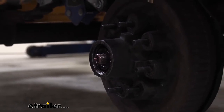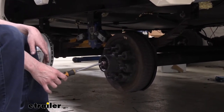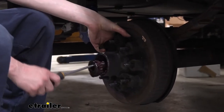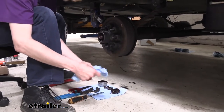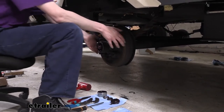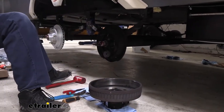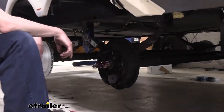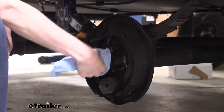At this point the whole drum assembly is ready to slide off, but there's a washer and outer bearing right behind it. Use a screwdriver to jiggle the bearing and washer just slightly out, then set them down. Grab a napkin to set the greasy assembly on, then slide the drum straight outward and set it down. Now that the drum is out of the way, we can remove the drum brake assembly from behind it. Clean the grease off the shaft first to prevent spreading it everywhere.